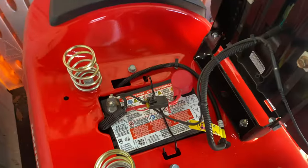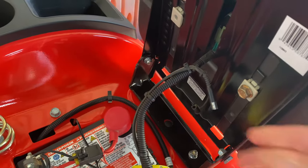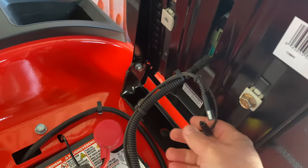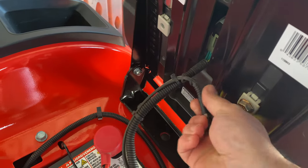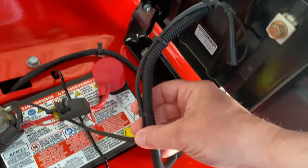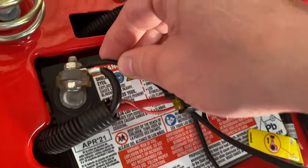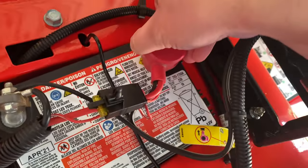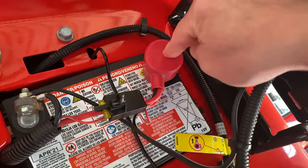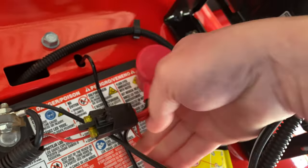The maintainer has helped me get three-plus years out of a mower battery that some people don't get a year out of. A viewer asked me to show my maintainer setup — they come with an adapter that I wired to the leads on the battery. It's a standard adapter; additional ones can be purchased. I'll link those in the description. I routed this with zip ties down the wire loom, because that's where a lot of the wires went to the battery anyway. You can see the negative lead there — black to black and red to red.